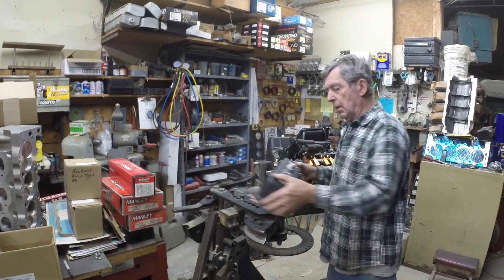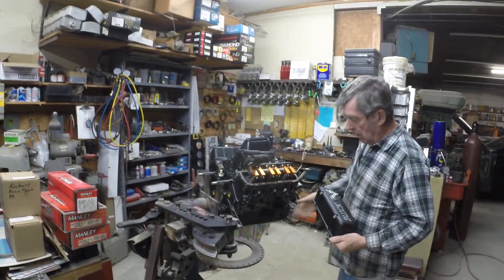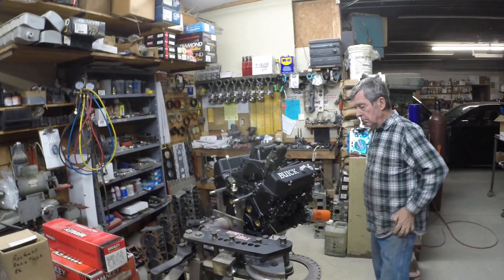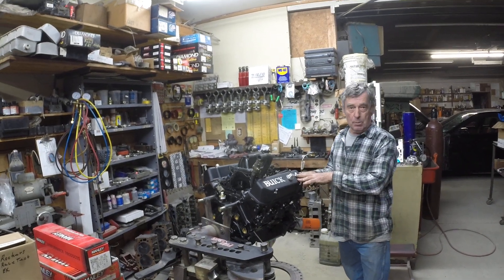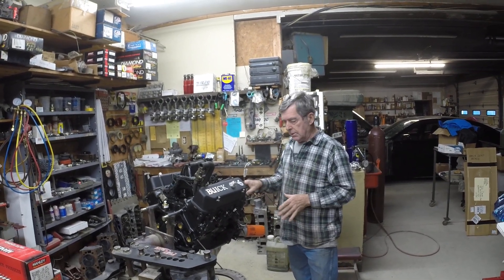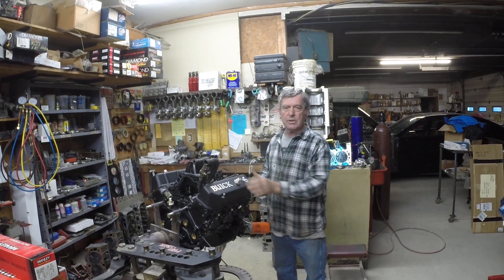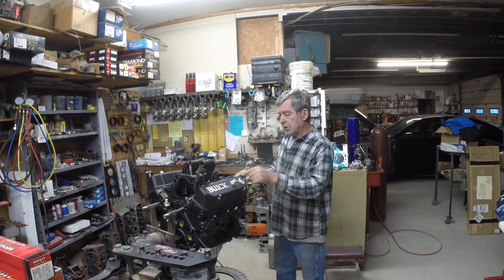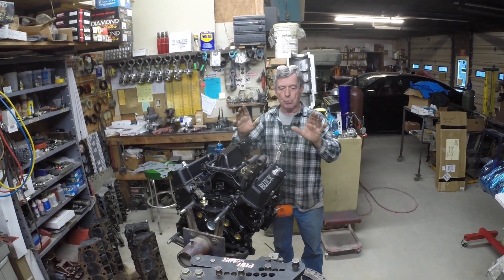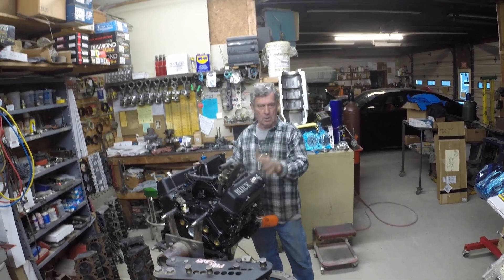When it comes to turbo motors, very, very important — John's beautiful valve covers, look at those things. They're very heavy, not tinny light things. Neither is that oil pan. Because with a turbo, you get a certain amount of crankcase pressure. A lot of people run vacuum pumps, but you can't run a vacuum pump on any car with a turbo. No matter how good the ring packs are, no matter how nice the cylinders, there's blow-by in the crankcase — it's just the nature of the beast. A lot of guys that run turbo say 'my God, I've got oil running down the sides of my valve covers.' Why? Because you're not getting rid of your pressure. John's case — we're putting two breathers, not one. Two. They run out through individual cans and breathe gently. So no matter how much boost he puts to it, it will keep the pressure in the motor very, very low — preferably zero.